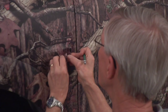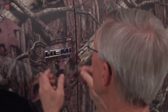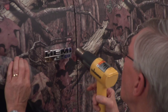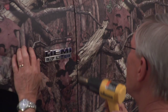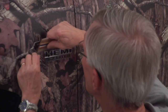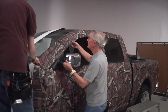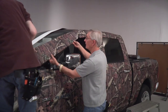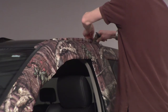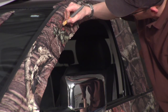Take a sharp exacto knife and carefully trim around any plastic badges. Working with heat around the emblem, you can see the heat will reduce the wrinkles. Work the squeegee on an angle left to right to push that material down into the groove. Once the backing is pulled free, come back and apply your piece for the roof onto the truck and put it into position — you can see it fits perfectly on the body line of the vehicle. Go back over that edge with your squeegee with firm pressure, finish out the trim, and keep your knife edge flush with the paint.